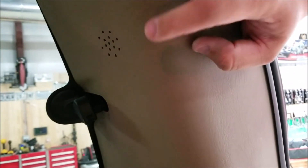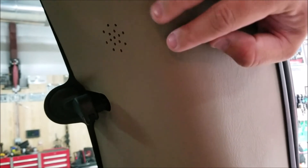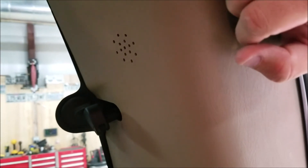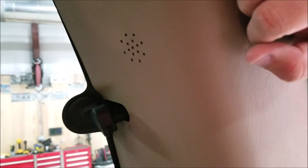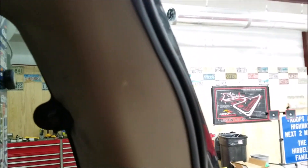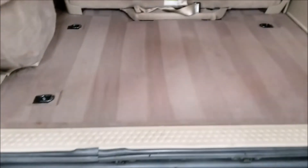The speaker is plastic-riveted in with two rivets, plus a connector. I use sheet metal screws to reattach it with some rubber grommets so it doesn't rattle around. I went ahead and replaced that because I thought that was my cause — it was a cheaper option versus replacing all the backup sensors. Between the two fixes, that got us back in business. Now we're good to go.